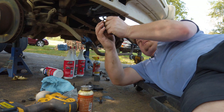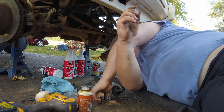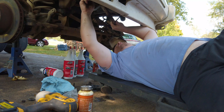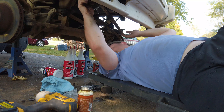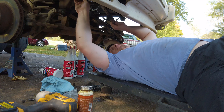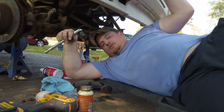So we're going to try to stick this side up here and get it started. One thing you don't want to do is run these down super tight, because you've still got to align the ends over on the side. So don't run them all the way down — just three or four revolutions to make sure they're holding, but leave some slack so that if you need to make adjustments for the pins at the end to go in, you can.